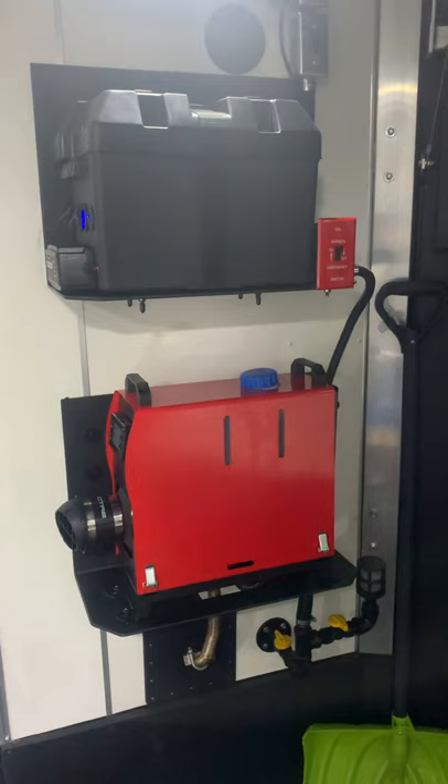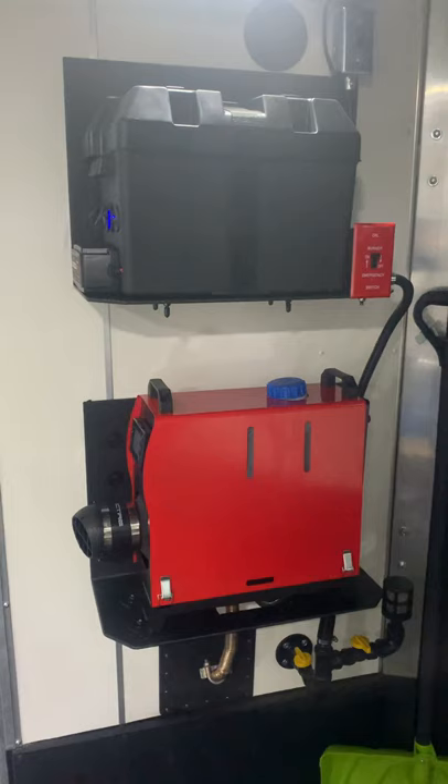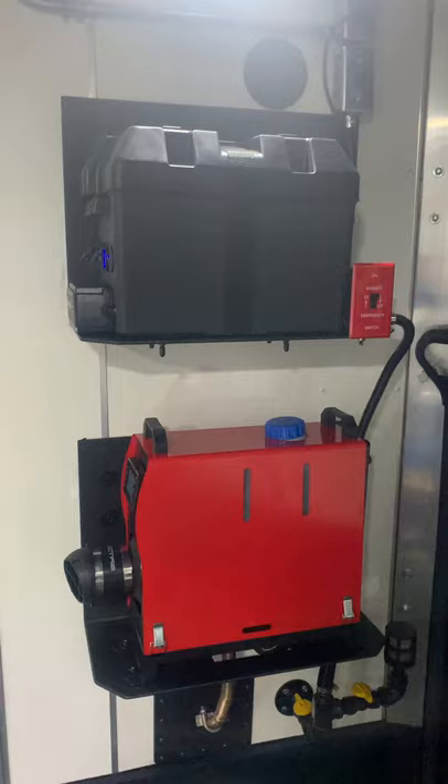Wall-mounting this was pretty simple. I took some flat stock — 20 inch wide flat stock. The trailer's got 16 inch center studs, not a big deal. Bent them in the brake, line-x'd the shelves, and 45'd the corners so you don't get any sharp edges when you walk into them.